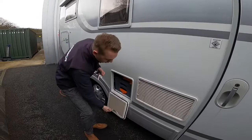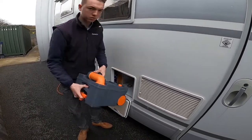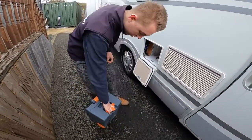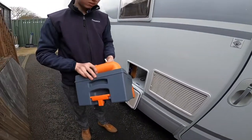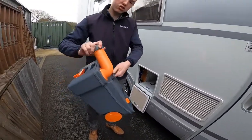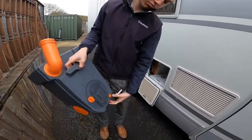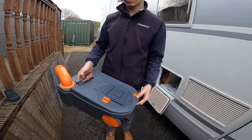This is your cassette - the blade must be closed to lift this orange handle and slide out on wheels so you can drag it to the site instead of carrying it to your disposal point, which is normally beside or behind the toilet block. You then take the cover off, press this button and empty. Once you've emptied, put some water in and give it a little rinse.